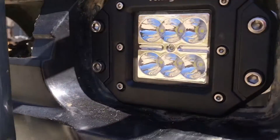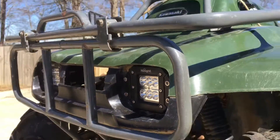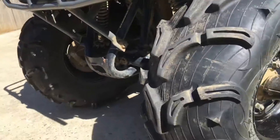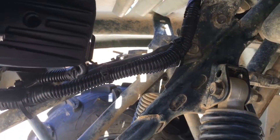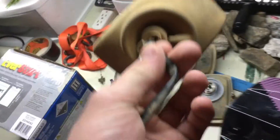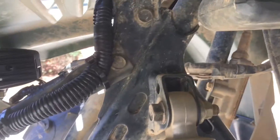Looks really good in my opinion. This is a NiLite — I'm not sure exactly which model — but the spotlight looks nice. Looks really good. For wiring, the wire just came straight from the LED itself, and I tied it into the factory wiring harness for the high and low beam headlight circuit. All I did was basically cut into the wiring harness that goes to the bulb itself and spliced right there.